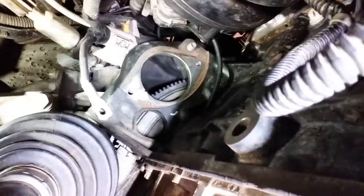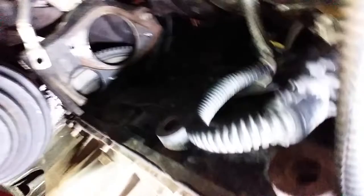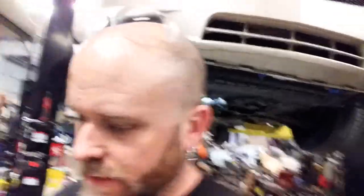If you have a part that is literally a pain to get to — that's the starter right there. That top hole is blocked by the intake manifold completely, and it's against the block on the back side. So that tends to be a pain to actually get to. You can fish an extension with a socket in behind it, but you're blind, you can't see anything — you literally have to have somebody up top and you underneath.